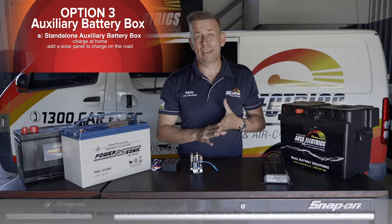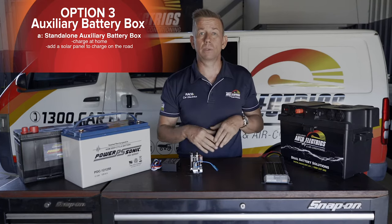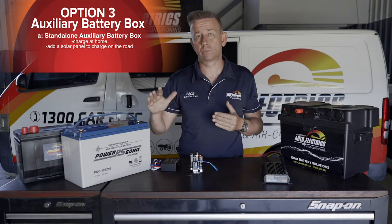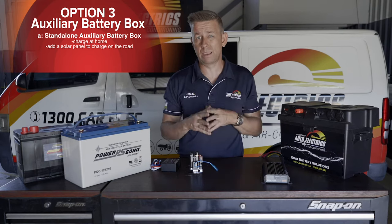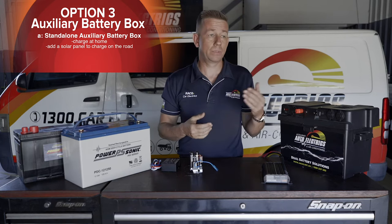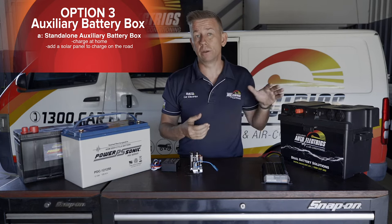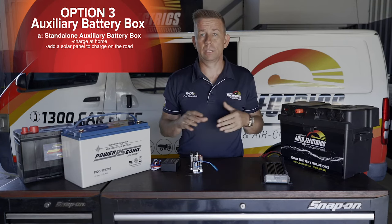The main problem is battery lifespan — it's permanently getting discharged and recharged with nothing in between, so it's not a good way to keep the health of your battery. And if you're away camping and somebody leaves the fridge door open, the fridge doesn't cycle, the battery gets hammered — and that's it, you're stuck.